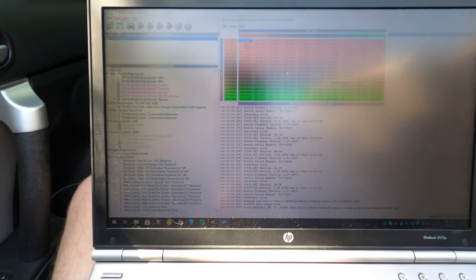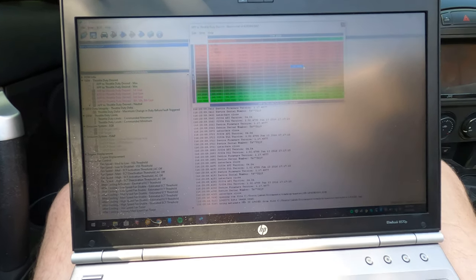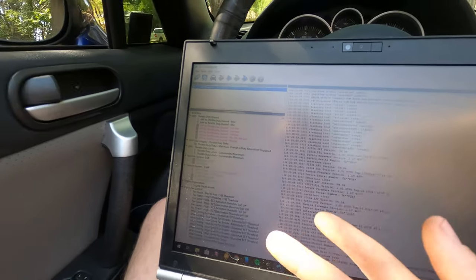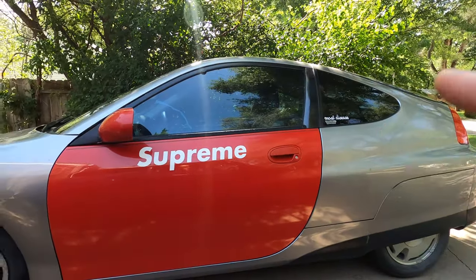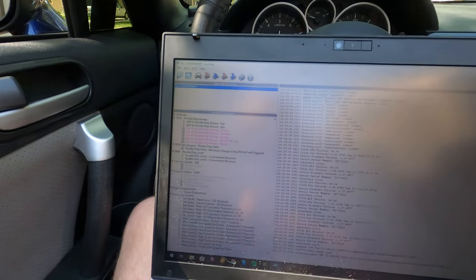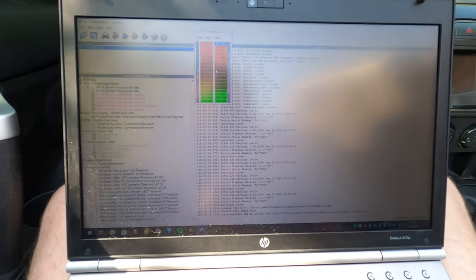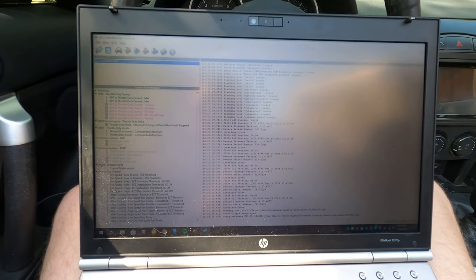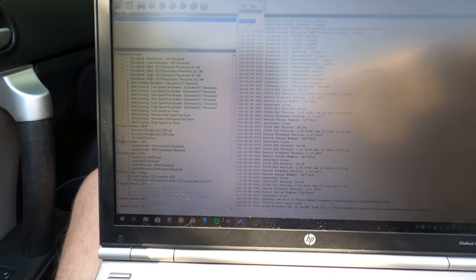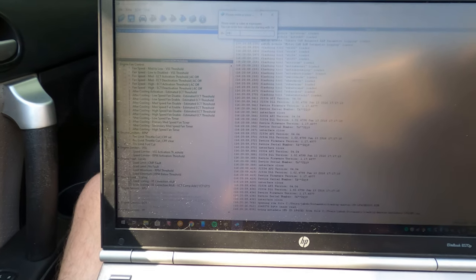Oh, and apparently neutral is also strange. Why is neutral strange? I don't understand. I'm sure there's reasons for this. It's like in that thing. You can buy a box and that one actually has one to change this exact thing, so that it's easier to stay in lean burn mode. I'm sure this is just to make it easier to drive the car more economically. I don't care. Rev limit fuel cut is 7,000. I'm going to make that equal 7,400.